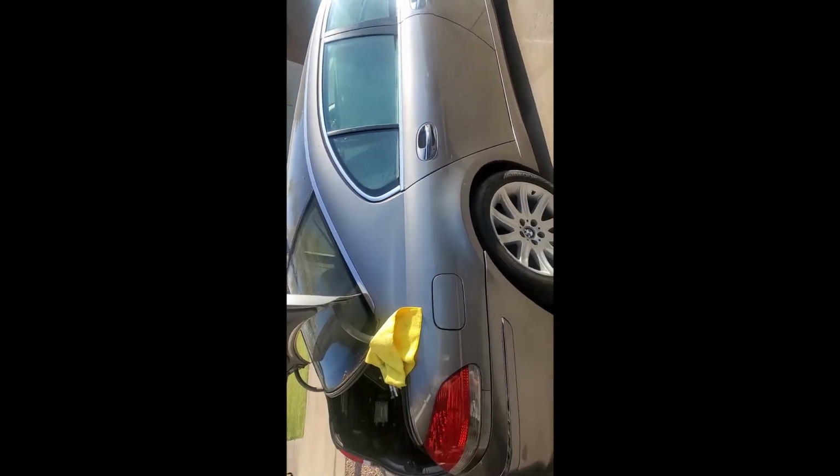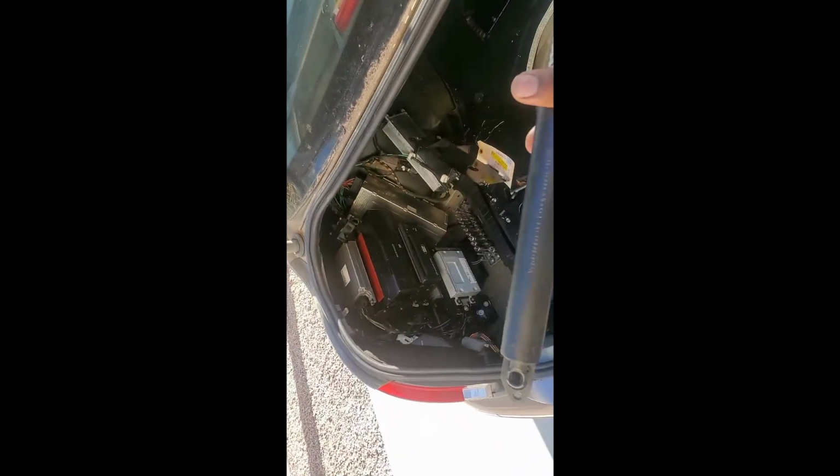We're working this E66 BMW. That beautiful one right there. So as you remember in the last video, the automatic trunk wasn't working. We pulled everything apart and diagnosed that the rear springs were shot. And the hydraulic cylinder here, which normally bolts right above these trays, was leaking. So we ordered a new cylinder, which comes with the lines. We ordered new springs, which are right here. And we're going to install them.